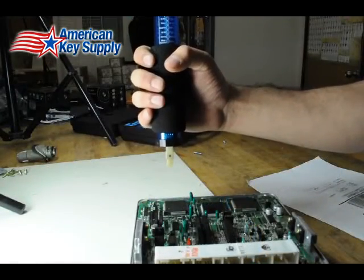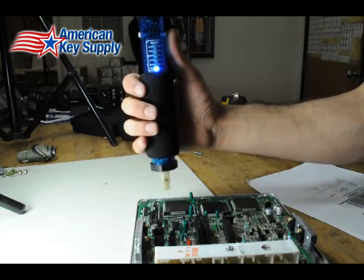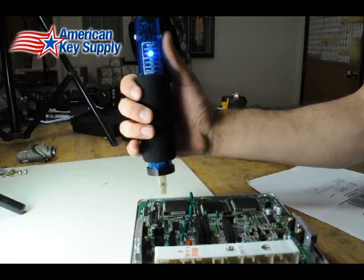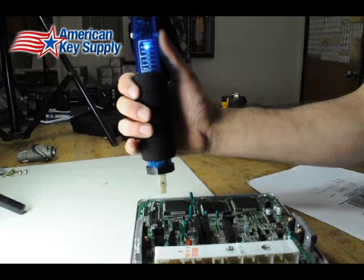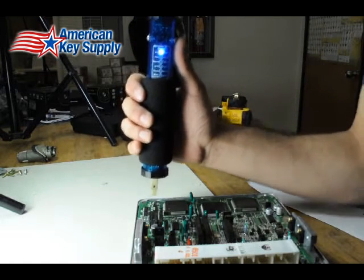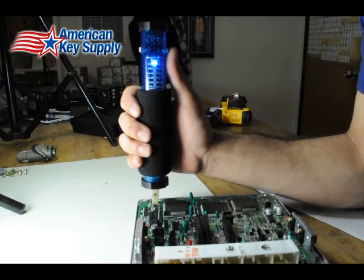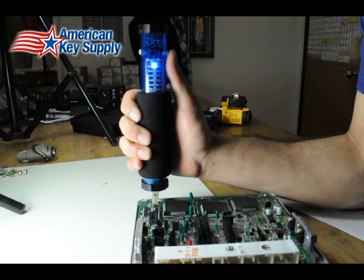Alright, when we're ready, we turn the power on by pushing the button on the top. When it starts blinking, you make your selection by scrolling through until you reach type 1 or 16-bit for this kind of car. Then it blinks, telling us it's selected. Now go ahead and seat it on top of the chip. Make sure you're really straight, and then push all the way down so it touches all the legs, and push the button when you're ready.